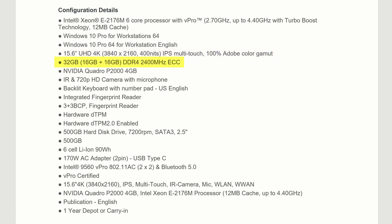This laptop actually supports 4 DIMMs of RAM. I'll show you how to upgrade the empty slots a little later. I went with 32GB, and ECC happened to be the same price as non-ECC, so I chose to match that with the Xeon.